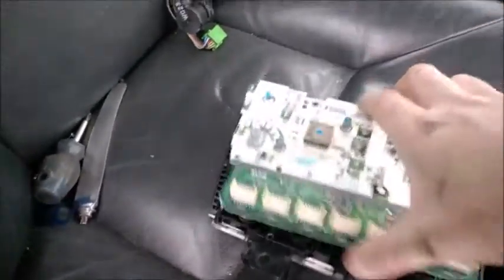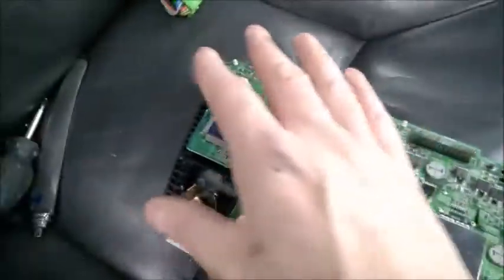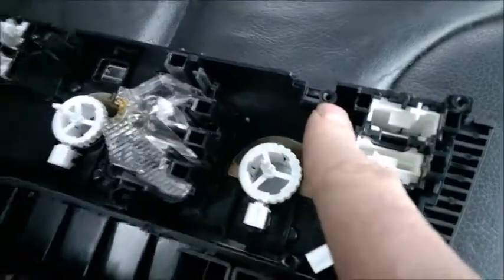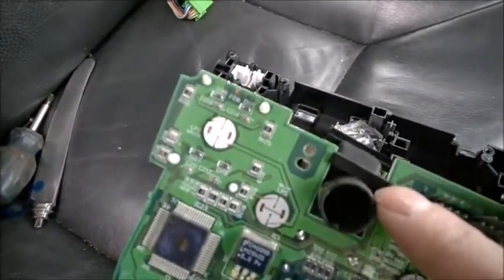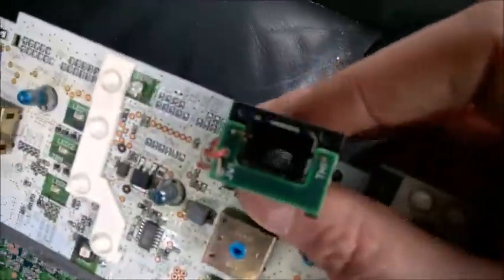The printed electronic board has four screws and two small plastic pins. When you finish with the screws and pull on it, it will feel like it's stuck — that's because of these two pins. Just break them off with pliers, crack them so it pulls free. You'll notice it pulls with the thermistor assembly because it's stuck in there. Just pull a little bit to detach it; it's not secured with anything.